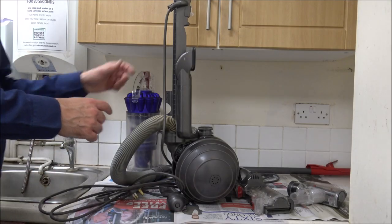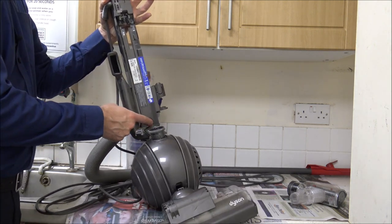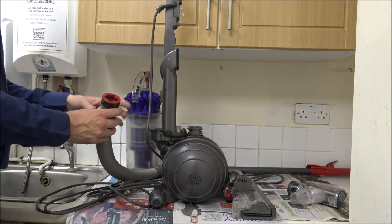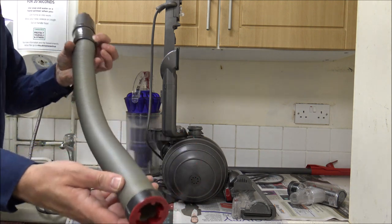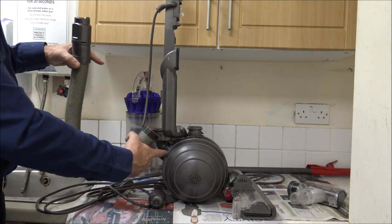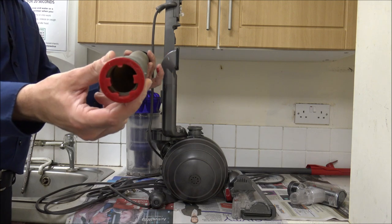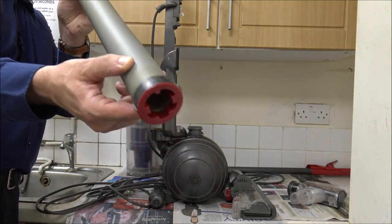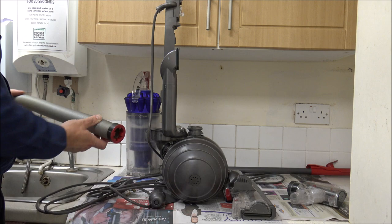One thing Dyson have done well over the years is give us the ability to remove the hose at the back. You've got a little red button, and basically if you press that from that side and then just give it a quick pull, then we've got the ability to take the hose out. That's really good for a couple of purposes - first it means you can take it out to clean it, and also if there are any blockages down the back here, because it's on like a U-bend, then it's really easy to take the hose out. Overall it's probably just over a metre long, and if you straighten it out you can see whether there are any blockages in there. I can see there are no blockages whatsoever, so that's always a really good sign.